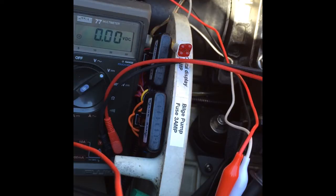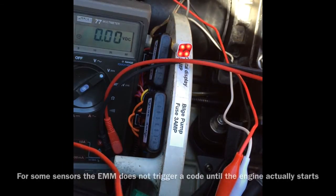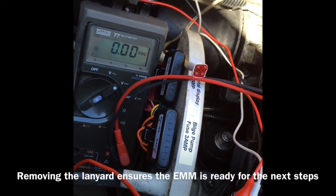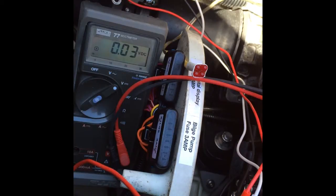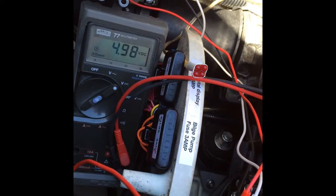The TPS switch is off, which is essentially the same as fully grounded — below idle position. I'm going to start the ski, put the lanyard in, then remove the lanyard. Presumably by now a code has been set. Turn the switch on, which is full 5 volts. Lanyard goes in, switch is on — 5 volts into the TPS signal wire. We have codes flashing here.